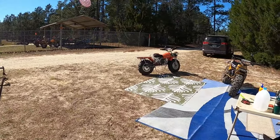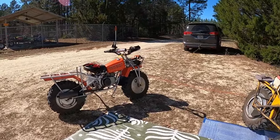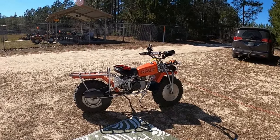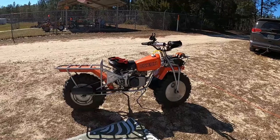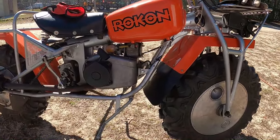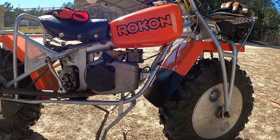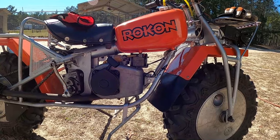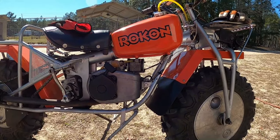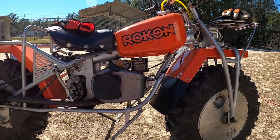But this looks like an original motor, so this is an older one. That's a Power B, yeah. That's probably West Bend. Is that a West Bend or a Chrysler or U.S. Motors? That's a 1963. That's early. So West Bend originally made these motors. It's 134 cc, two-stroke single. And then West Bend went out of business and Chrysler started making that motor. And my '83 bike's got the Chrysler. And then Chrysler quit that and U.S. Motors bought it. And then U.S. Motors has just discontinued it and another guy's picked it up. Oh, another guy's picked it up just recently. Yeah. So parts are all available.